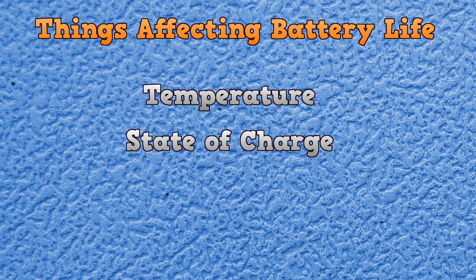Charging state matters. For example, if you were to let the battery completely discharge and then sit it on a shelf for a year, you can pretty much kiss your battery goodbye because it's going to be dead. If you're going to store the battery, take it out of the laptop so it won't discharge as quickly and try to charge it up periodically. If the battery is internal and the computer is going to be stored for a while, periodically make sure to charge it up.